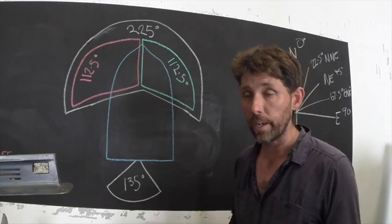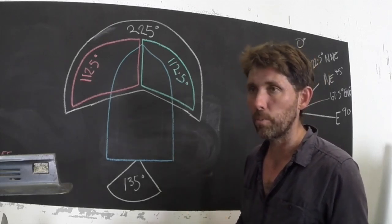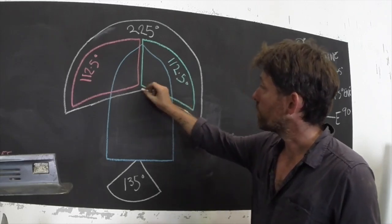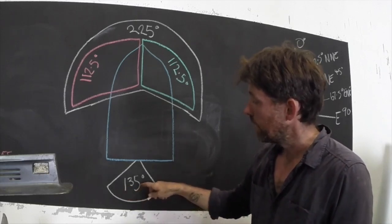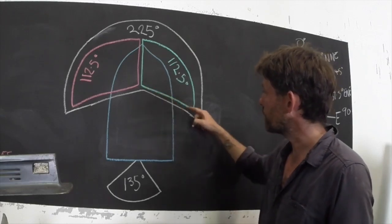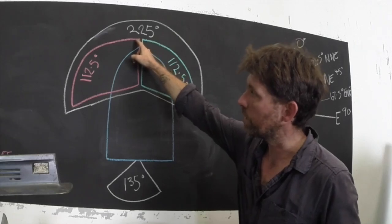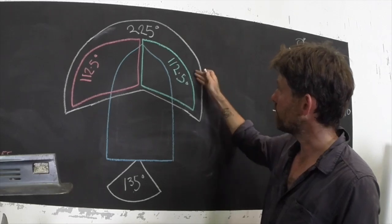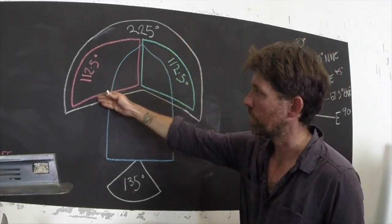You might have them wired up correctly, which we'll go through later, but that doesn't mean they're actually achieving their intended purpose. The way lights should be on a small boat — and by small we're talking under 12 metres — the collision regulations stipulate below and under 12 metres there's supposed to be a white masthead light that shines 225 degrees around, a stern light that shines 135 degrees around, and they add up to 360. So wherever you are around the boat, you'll see a white light. When you get to the exact same angle that you start seeing the masthead light, you'll start seeing the starboard green light for 112.5 degrees, and eventually it cuts to the red port light for 112.5 degrees. From the back of the boat you'll only see the white light; from the right side you'll see the masthead and the starboard light; from ahead you'll see masthead, starboard and port; and from the port side you'll only see port and the masthead light.